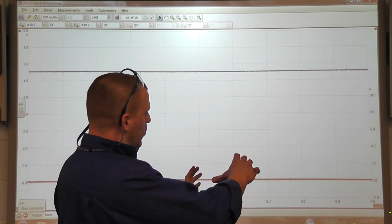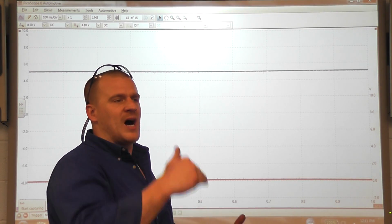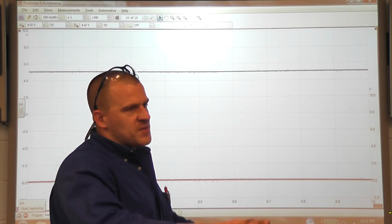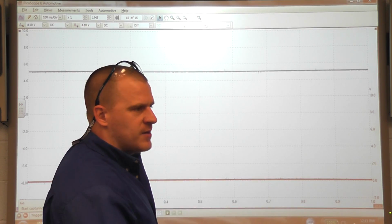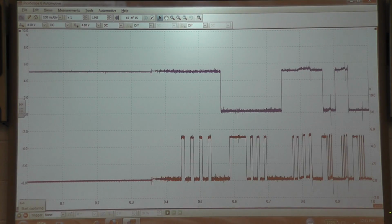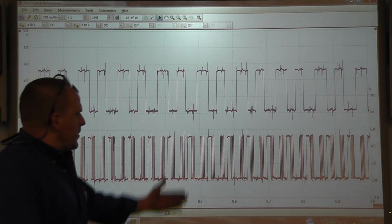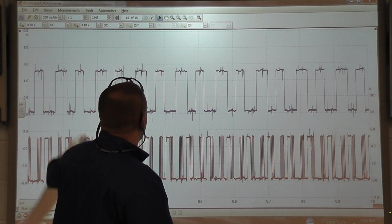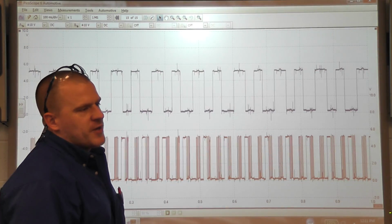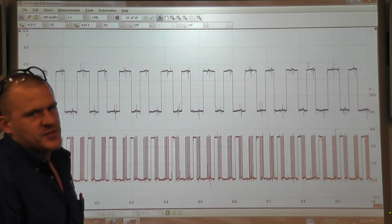And dependent on where that crank stops in position, that signal is either going to be high or low. So it's normal to be fixed low with just a key on, dependent on crank position. Go ahead and crank it, see what happens. Crank sensor signal, cam sensor signal, got a little bit of noise in the picture. We could use the sensor ground to clean that up a little bit. Again, I can put filters in here too.